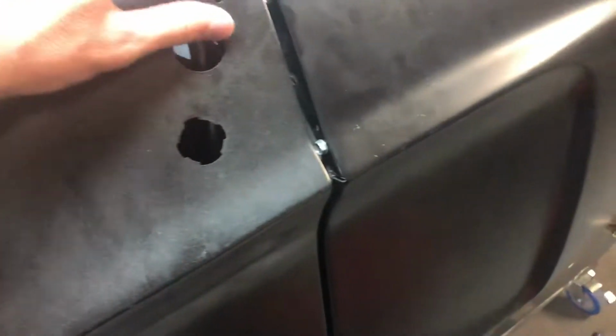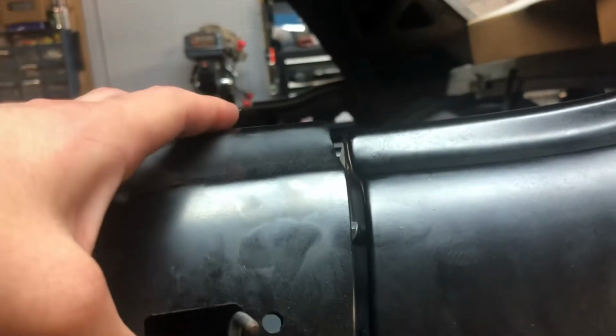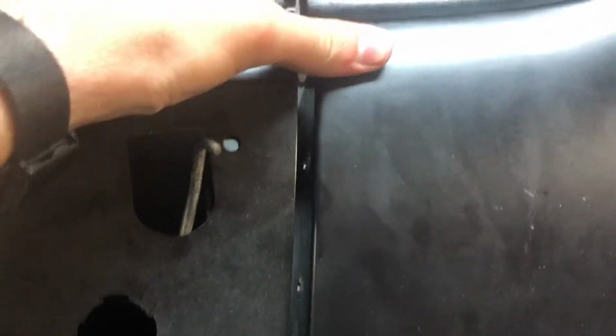We adjusted the door again and this is off yet some more. So, the door though. I went ahead and mounted up my striker again. Got it in. Door's preloaded, as you can see. Well, maybe you can see. I gotta push it down some to shut it, back to where it'll sit with the seals on. Gap's not terrible. I can do a little working with to fix it.